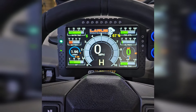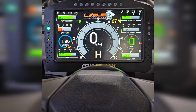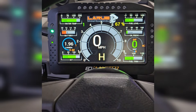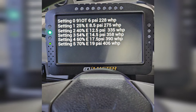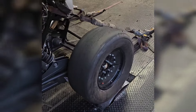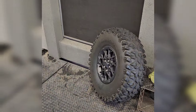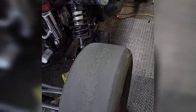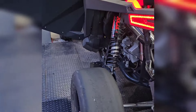Welcome back guys — it's not tomorrow but it's second shift and we're going to give her the hoopla. As you can see we have 67% ethanol and that unlocks setting 5. I've updated the horsepower numbers here — that's what she's currently making. Give you a look at what the tires are showing us. We went to the slicks. Stock tires were spinning a little too much, so the slicks yielded some more power. As you can see it's still peeling off rubber, but let's see if she makes the horsepower again.